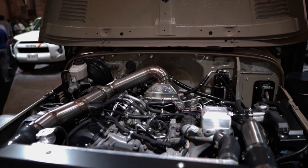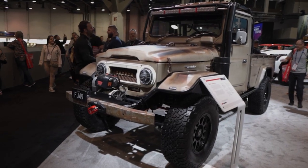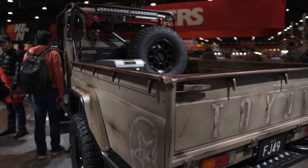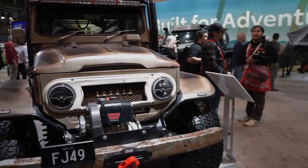So we had to use a couple of tricks and build the CAD first, but the chassis cut out a tiny bit. I just had to fit the oil pan in between the chassis rails of the original 45 chassis, and then just had to change around a couple of things because it came from the factory with a top mount intercooler, so we had to front mount the intercooler and make up a whole new exhaust, and the steering column is about that far away from the engine, so we had to make sure that it didn't rock so it would push in to that. But it's tight, but it works. Definitely. He said a little bit modest when he said I had to change around a couple of things. Yeah, it's a lot of modifications that had to be changed.